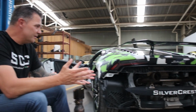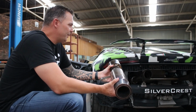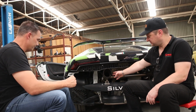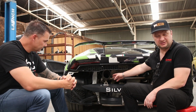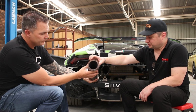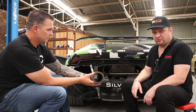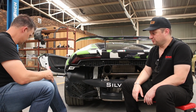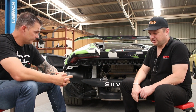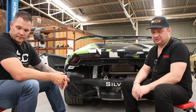Okay, so Ivan, in terms of the old straight pipe that you showed everybody early on, which was my pipe, how would you compare the sound of the new H-pipe to this pipe? So this is actually straight through because this pipe has no baffling, no silencer whatsoever. Your old pipe had an actual silencer, so it does silence the sound. So this will be quite a bit deeper and a lot more raw, because here we've got absolutely zero baffling. It should be very similar to the Performante sound, being also a straight pipe.